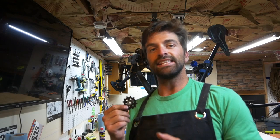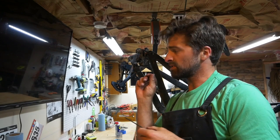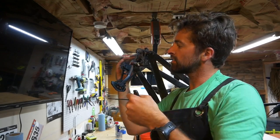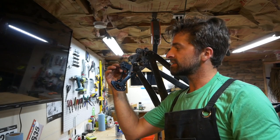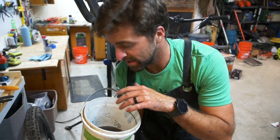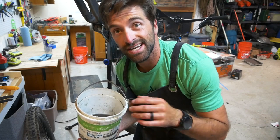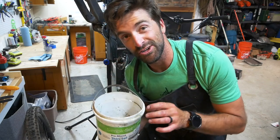I just scrubbed that bearing, cleaned it off, and put a little dab of grease behind it before putting the covers back on and reinstalling it. It's now free-spinning — not even sure if it was supposed to be free-spinning compared to the lower jockey wheel, but it's at least not gritty anymore. Now with the derailleurs and front chainring all set, we're going to put the chain back on. You know how I said I usually put the chain in a bucket of soapy water? This chain has been cleaned a couple of times while you watched, and it's a black pool — your chain can always get cleaner.